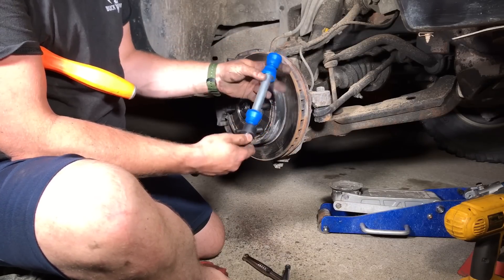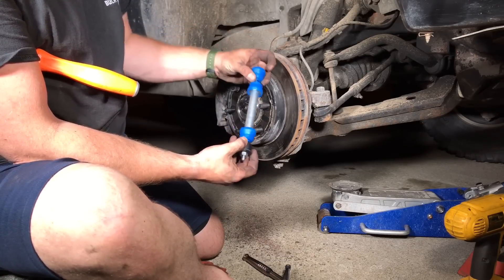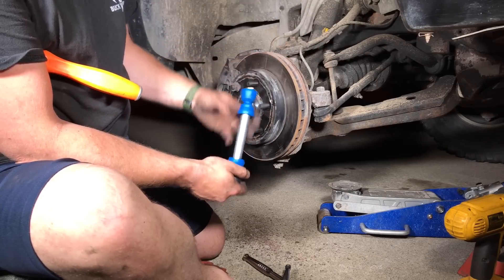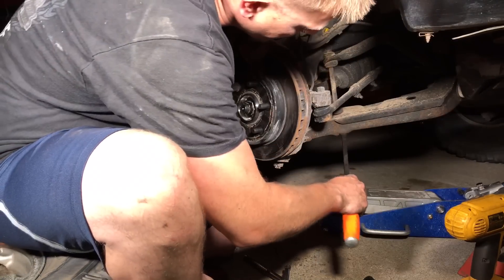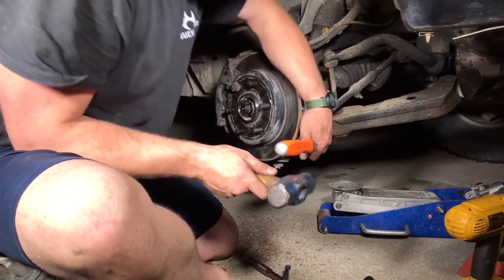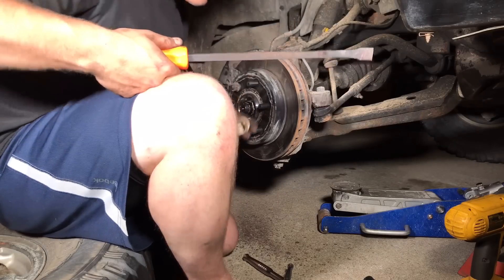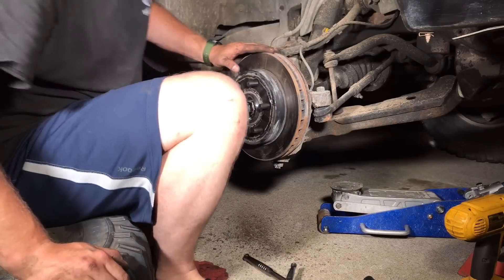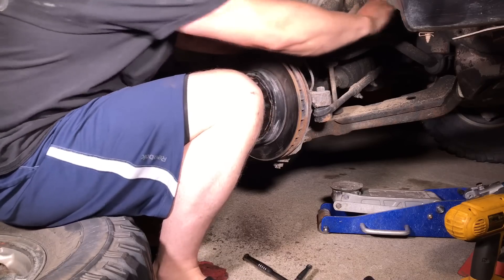It's pretty simple. You just have a really long bolt with some spacers, and basically you have some rubber that isolates the sway bar and connects it to the lower control arm — we're just going to replace that. The first thing we need to do on this one is remove a cover. I don't know why they have a cover there, but we'll pop it loose — try not to totally destroy it. They're free. It's a little plastic cover; it's probably not going back on. More weight savings, you know. Looks like we've got a 14mm on the top here.